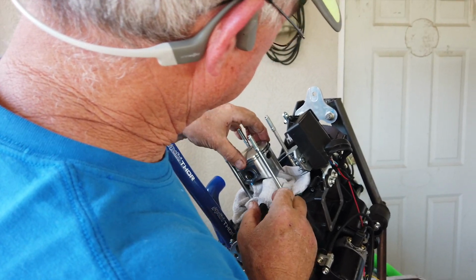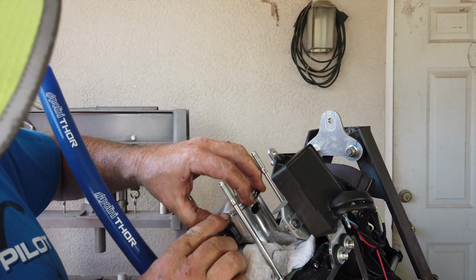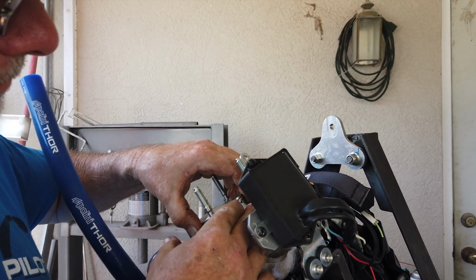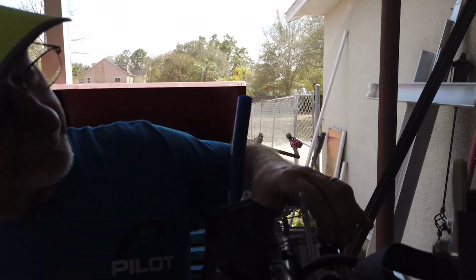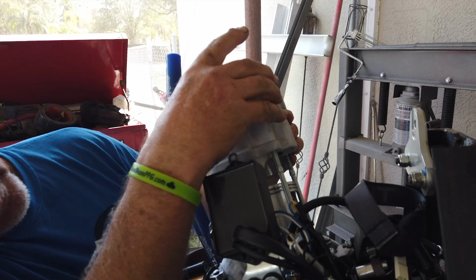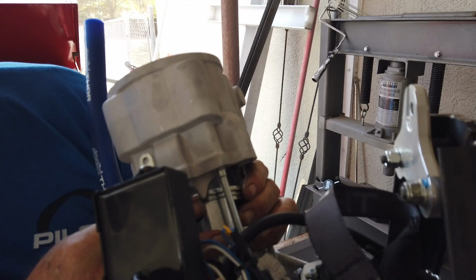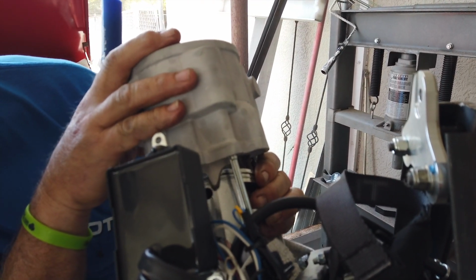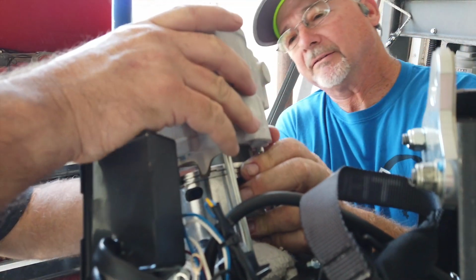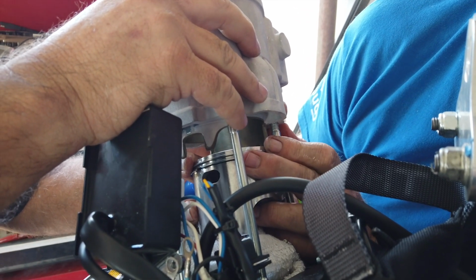Now make sure our little rings are placed right. Where are the stoppers? They're there. As you reset your cylinder, you have to make sure that the rings are in the proper orientation. There are little tiny stoppers that fit in the gap of each ring. One of them is facing the exhaust port, and the other is oriented 90 degrees to that one. So make sure that your rings are in the right position with the little stoppers in the gap of the rings before you slide the cylinder down over the rings.